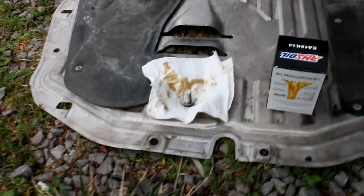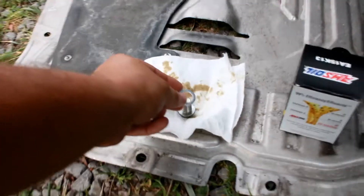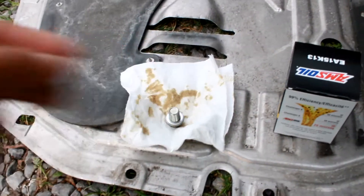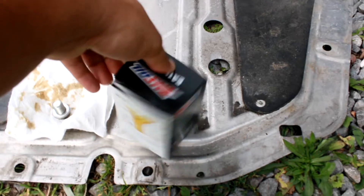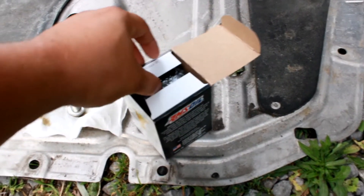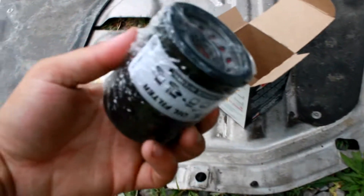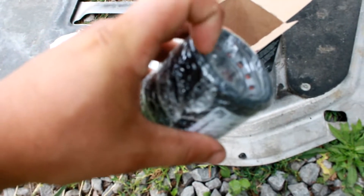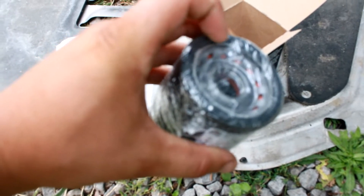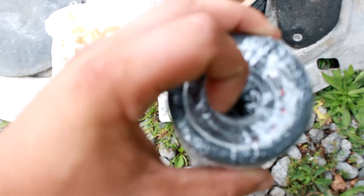Here's our oil drain plug — I've already taken off the crush washer and I'm going to replace it with a new crush washer I got from Honda, it was like 67 cents Canadian. Here's the oil filter I got from Amsoil — I'll be doing a full Amsoil oil change. What I'm doing here is showing that before I put this on the car, I get the gasket and put a whole bunch of oil on it, and I also pre-fill the filter.